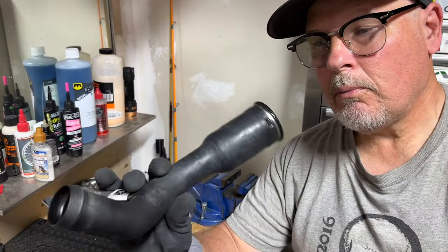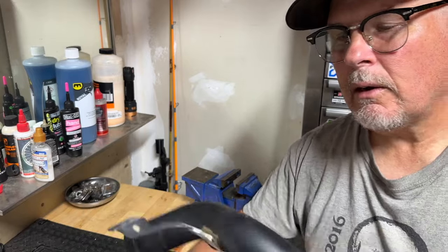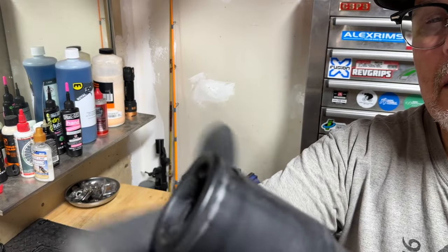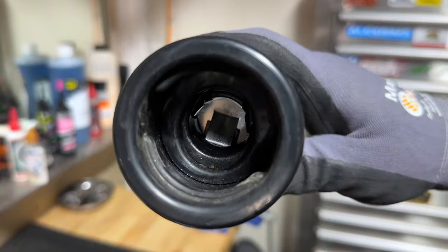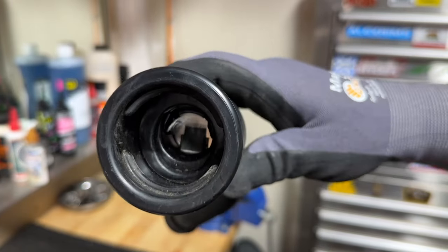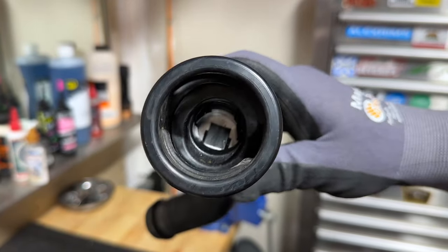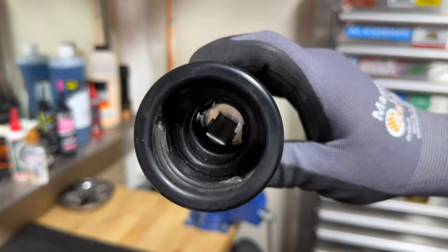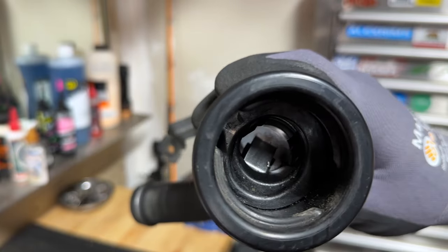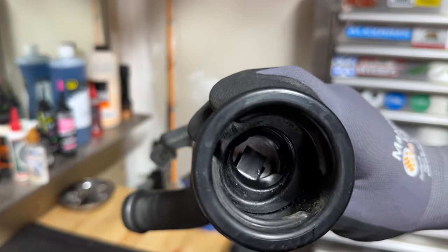Here is the fuel filler portion of the fuel filler pipe that I took off. It has this bracket that holds it on, and the hose clamp goes around there. This end is where I'm going to finish up the job — this portion has to come out, and inside you can see the discriminator down in there. That is the discriminator that stops the full-size diesel hose from getting in. I didn't see any great information on the internet about how to do this, but removing this part is going to let me use the big diesel nozzles at the truck stop, where you can often find cheaper fuel.